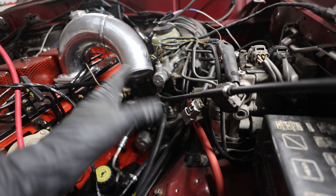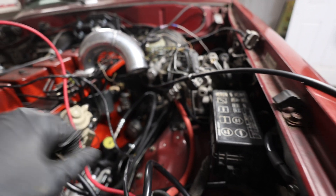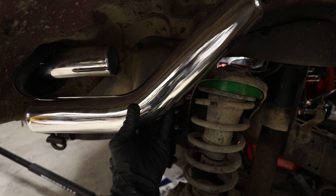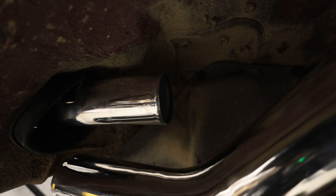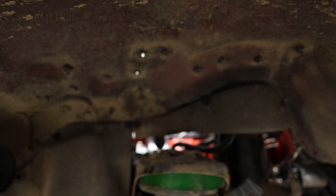We're gonna have a hump hose here, which is basically an intercooler boot that allows some flex when the engine's going left to right so it doesn't cause any issues bumping into things in the engine bay. We also want to make sure we have the least amount of bends possible, because that's gonna make building boost more difficult. We can always cut right around where that weld bead is and then clock the intake a little more down as well. We've marked where we need to take off a piece of this three-inch intercooler piping, so we're gonna use our Bauer chop saw to take that material off.